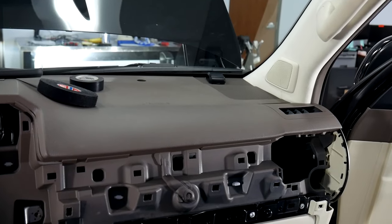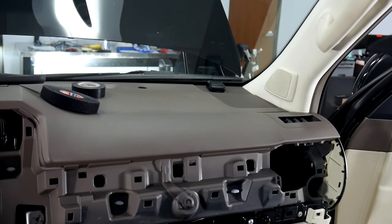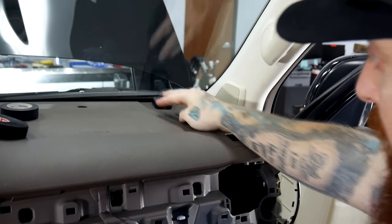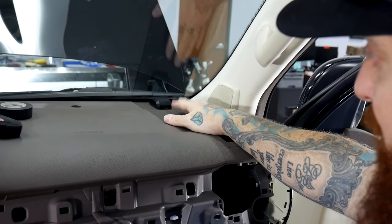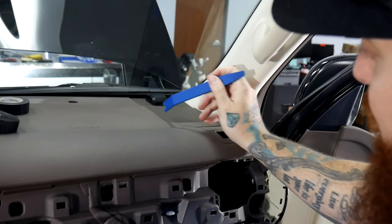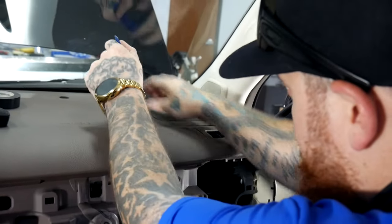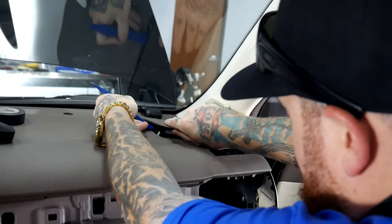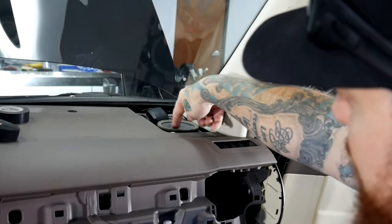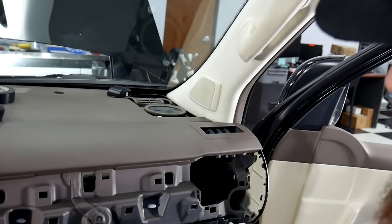Now it's time to run the GPS antenna. For this you are going to need a zip tie snake — it's a two-foot zip tie — and a panel pry tool. We chose to put the GPS antenna in clear view right on top of this speaker grill. The actual speaker is here so you're not blocking anything. I'm just going to pop this speaker grill off — just like so — once again just clips. Here's your speaker, and the antenna is going to sit just right over top of basically nothing, so you don't have to worry about anything being sacrificed here.